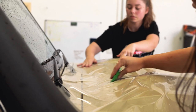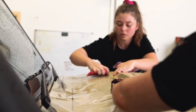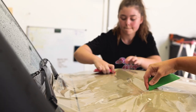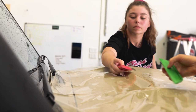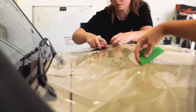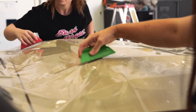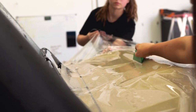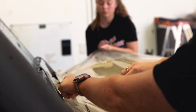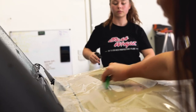You can then squeegee that away. Be very thorough with your squeegee in this recess, because on any sharp valley on a vehicle you really don't want to be syringing it — there's a chance that once the film dries out it may pop back up. It's normal that there are fingers over this bridge line here; just be really careful and massage them out. Now we just work this film to the back. There will be some fingers — there has to be some fingers on this bonnet, it's just the shape — so we choose to put them towards the back, and they're actually the easiest to get rid of.